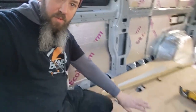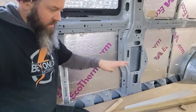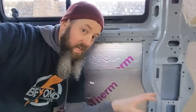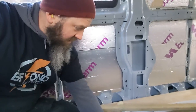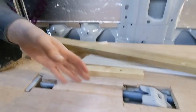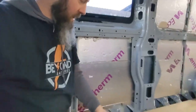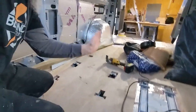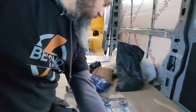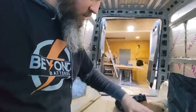I've done the routing on the biscuits for the biscuit joints. Now I'm trying to make sure the seats fit in nicely alongside the ply. The seats have a certain clearance underneath them, and unfortunately the ply is just a little bit too high, so I'm routing out some channels. The brackets for the seats slot into this little section here and then clamp down and bolt through. I've had a bit of an issue — the panel was all nicely done but the clearance for the temporary seat just isn't low enough; the ply is sitting that bit too high.